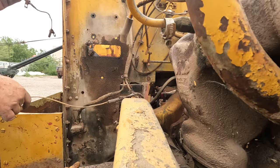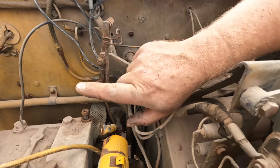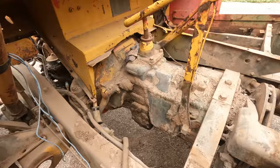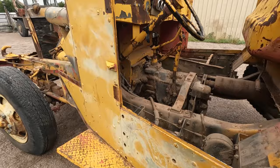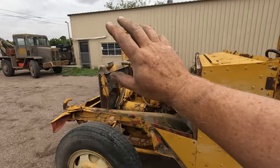I think I'm pretty much ready. I've got all the wires disconnected. I got linkages tied up that could get caught. Remember to get the ground strap, starter wire, all that. And the interior, pedal plate's gone. All this stuff is gone. I think we're ready to go straight up and it'll leave all the controls right here. And hopefully I got all the body mounts. I'm not sure. I got all the ones I could see. But we're gonna try going a little up once I maneuver everything around into position.